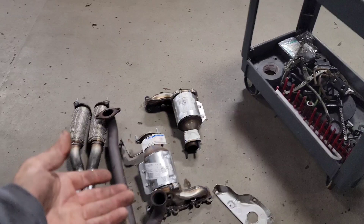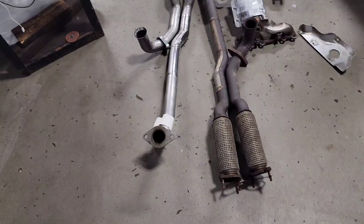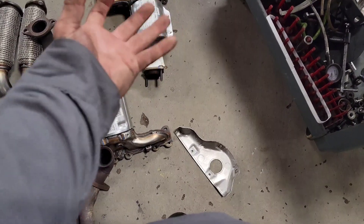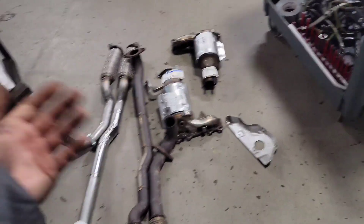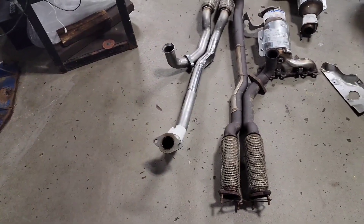The rear cat — but when you get in there and you start getting everything apart, you'll find that this exhaust, when you pull the intermediate pipe out of there, you look at the bottom of the catalytic converter in the back and it's coming apart as well, even though there's no code set. You may as well replace them while you're there because you're going to be doing twice the work pulling this stuff back down.